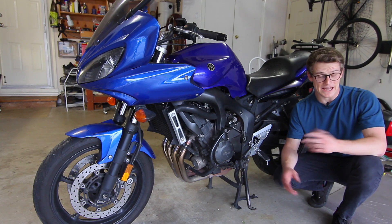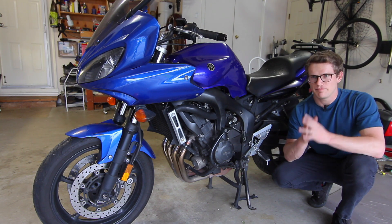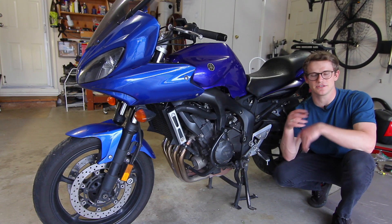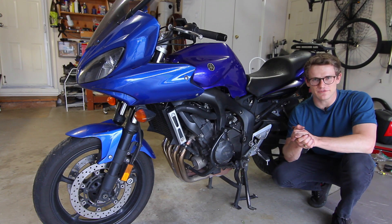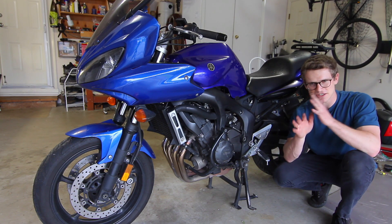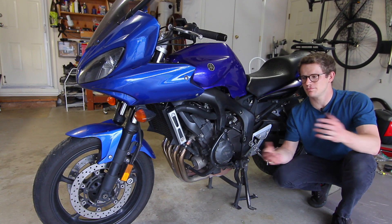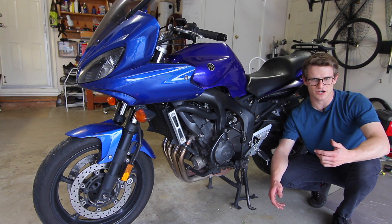That's a wrap on diagnosing and analyzing the coolant temp sensor in my 2007 Yamaha FZ6. It just goes to show that you can assess the coolant temperature sensor without removing it from the bike. Best practices would be to remove it and check it at both 80 degrees and 0 degrees Celsius to verify the full range of the sensor. But getting one test at 80 degrees without having to take it out, buy a new washer, or go through the hassle is a pretty good cheap solution. You could also use the environment to your advantage — leave it outside overnight, let it get really cold, and check the resistance to see how close it is to the 0-degree spec. Thanks for watching everybody, I hope you enjoy this FZ6 content. Please smash the like and subscribe button, and as always, have a good day.